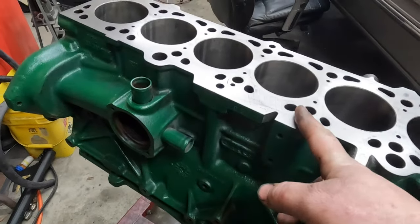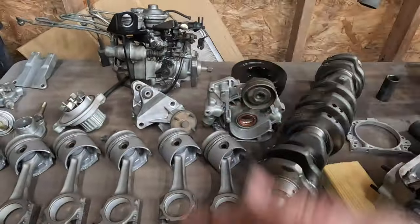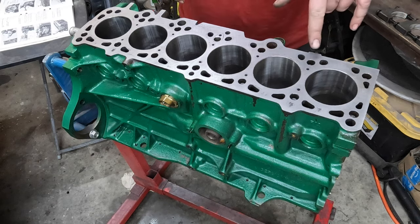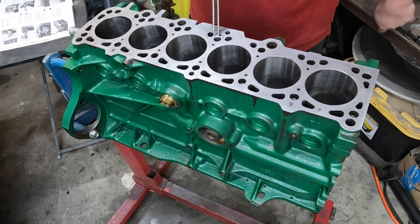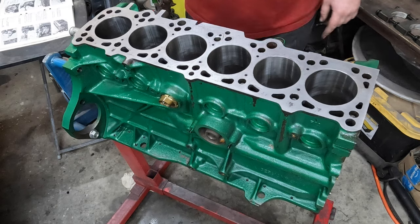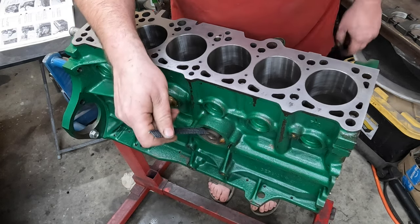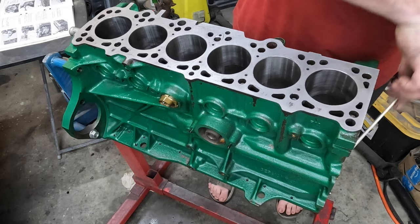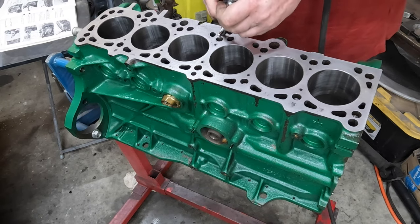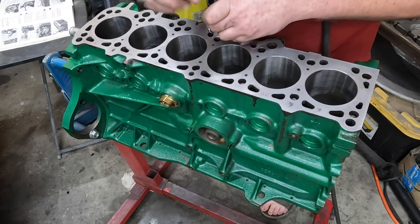We're going to start by plonking the crankshaft back into the block. The first thing we want to do before setting the crankshaft in is make sure all the oil passages are clear. This passage is your main oil pressure feed to the head that feeds all your lifters and your cam. There is an oil pressure sensor hole directly below it on this side of the block. The oil filter housing mounts there, and the inlet and output for the oil pump are over here. Going through this hole, it's mainly going to come out this sensor hole — plug that and you'll feel it coming out right here.